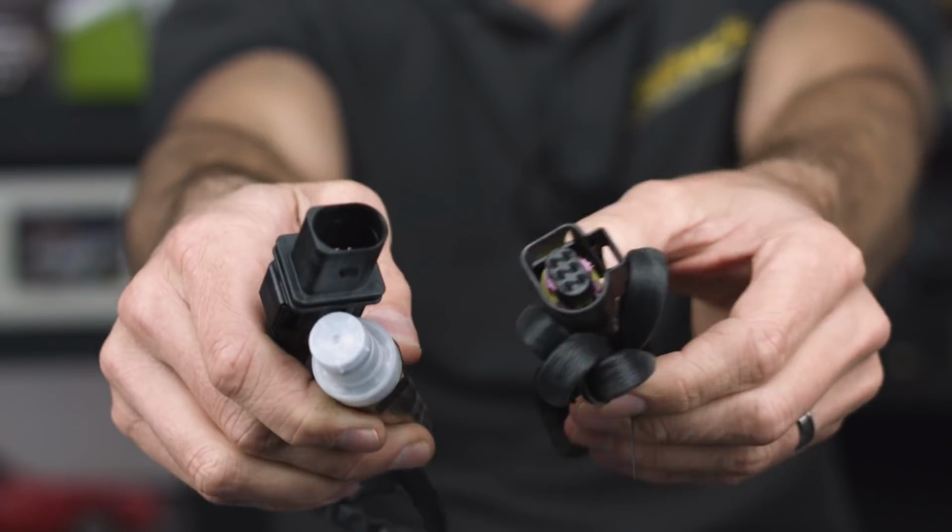One thing missing from the bottom of the ECU case is the familiar Deutsch DTM4 CAN connector. This is now pre-terminated into the 34-pin auxiliary connector, and for the first time you can run a 6-wire Bosch LSU 4.9 wideband O2 sensor directly into the Haltech ECU for onboard wideband O2 control. So for those of you wanting to run onboard wideband control, we also have the Bosch LSU 4.9 sensor kit available. There's also a 12 volt and a 5 volt power supply wire to supply power to your additional sensors, and a corresponding signal ground wire for sensor grounding.